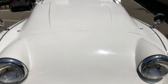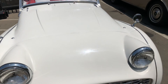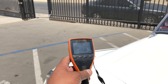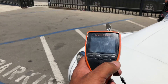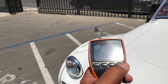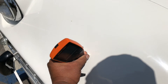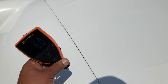Looking at the hood area, let's get some paint meter readings. This paint meter reads in thousandths of an inch. My first reading is 20.5. There's a default on this meter — a specific reading of 19.7 is an indication of body filler. So 20.5 is good. Sometimes when I get that 19.7 I'll retest just to make sure.